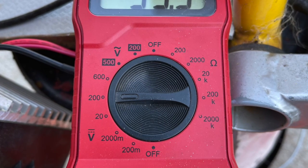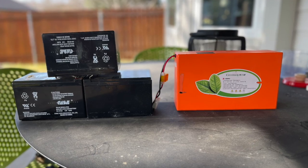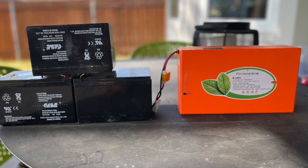The orange battery swap was a success — I kind of thought it might be, but I wanted to make this video for you guys who were unsure. A few things I wanted to mention: the battery we used was at 53 volts at the time of testing. This was a 19.2 amp-hour battery and it weighed 12 pounds. The stock Razor batteries — three 12-volt batteries — weigh a total of 23 pounds, so by doing this swap we saved 11 pounds just off the top.